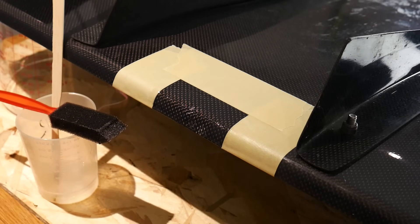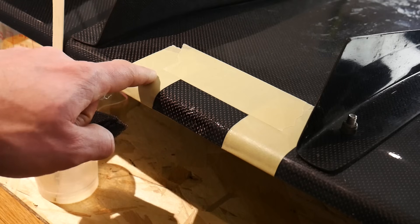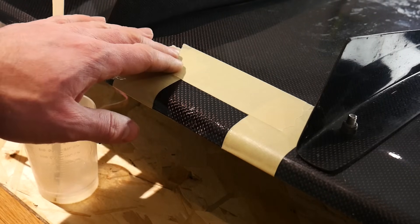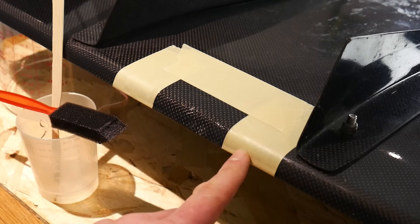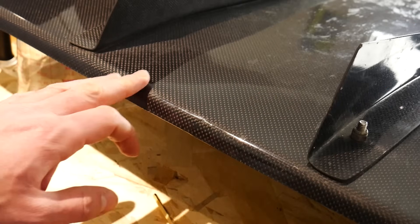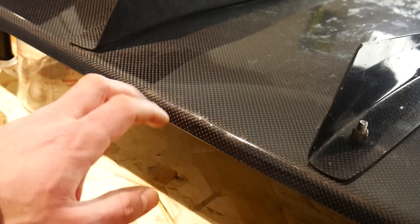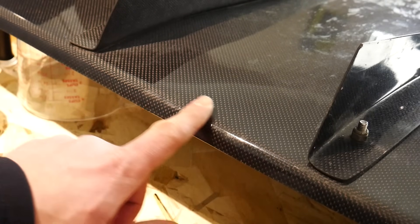This process requires a lot of patience — we'll need a few coats to completely fill in the crack. Depending on the resin and hardener you purchase, gel times will vary. I want to come back when the area is just tacky to the touch — not completely dry — and apply the second coat, then wait a few hours and apply the third. For me the crack was shallow so probably three coats at most. After three light coats, things are looking better — it's glossy again and you can no longer see where the crack was, but under certain light the piece is a little wavy.